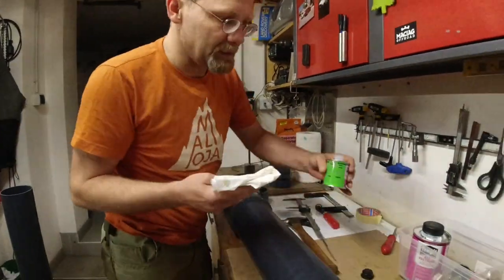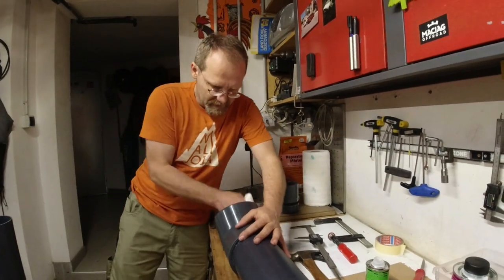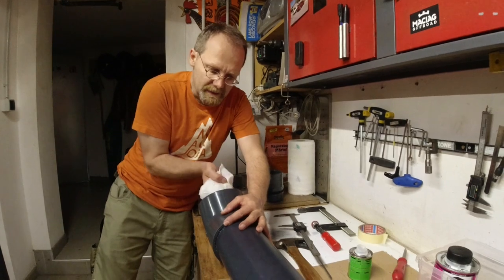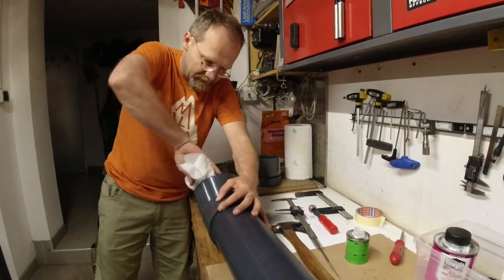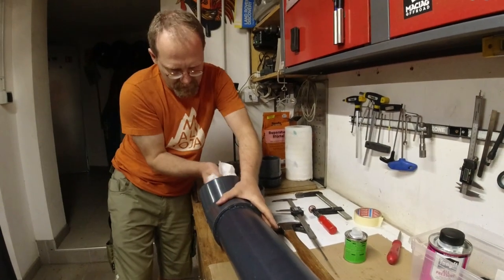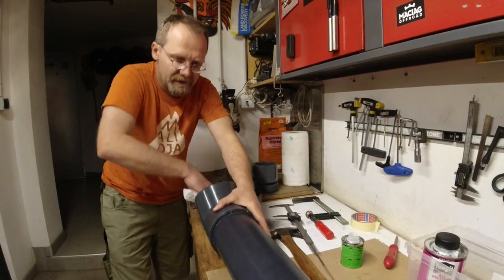First, you gotta use the cleaner, the PVC cleaner. Use plenty of it. And wipe this till it feels a little bit sticky. Yeah, it kind of dissolves the surface. Take your time, do that really, really careful. Especially when your wife is watching.